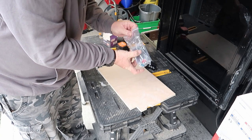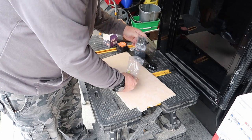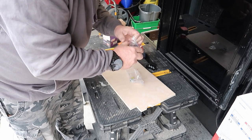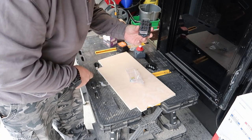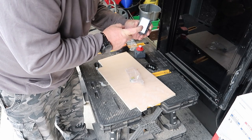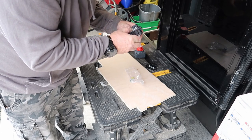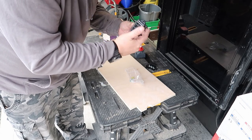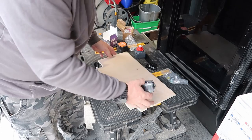And this little kit here is your blade fuse holder. See, one, two, three, there's only four on there. One would be the roof fan, one would be the diesel heater, one would be the lights, and one would also be a USB socket, which we'll put in there for them, so they can charge their phones in the back as well. You've got your in and you've got your out, simple. So now we just need to lay this out on the board.